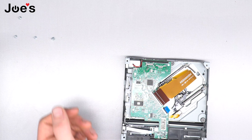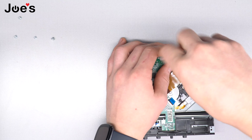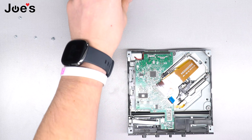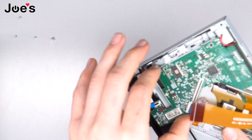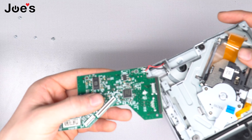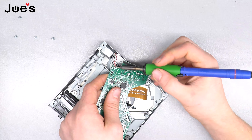If you want to just test to see if you can still keep the disc drive, you can get into the terminals, take it apart more and clean it. But for this video I'm just removing the board and we're going to be placing the board into a new disc drive. So remove the three screws here — and for this you will need a soldering iron. Unscrew those screws and the board will pop right out. You'll see two solder points — it's red then black. I'm going to grab my soldering iron and just carefully unsolder it, one point then the next.